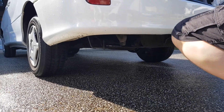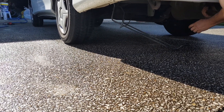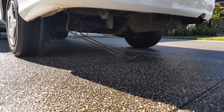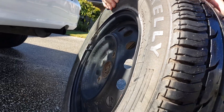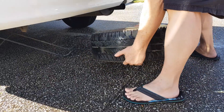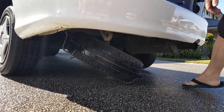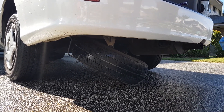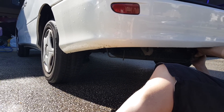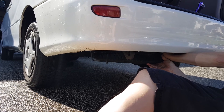Under here is a hook that holds this tray in. Okay, tray's down. Now you take your spare — you always put it in with the valve stem facing down so you can check your tire pressure on your spare without removing your spare. And it's best if you can get to it easily. Is that in? Yeah. Now this is the break-your-back, get-wet part. That's in.